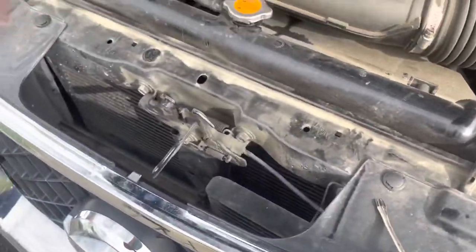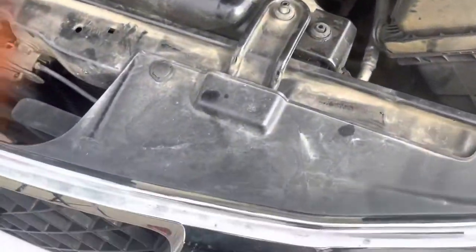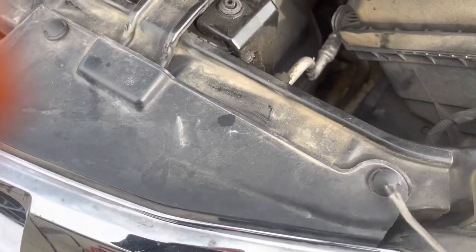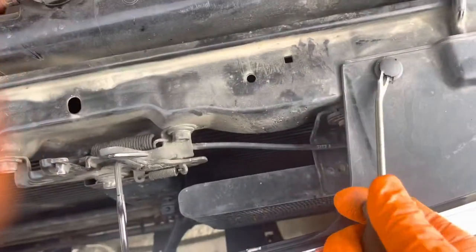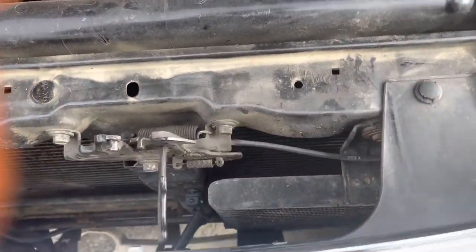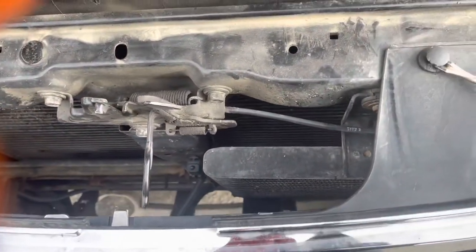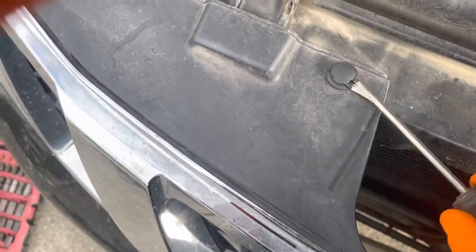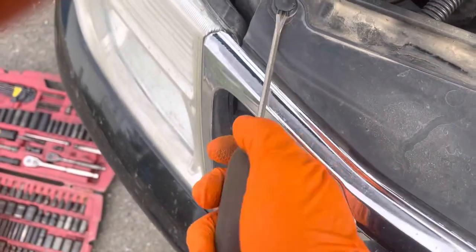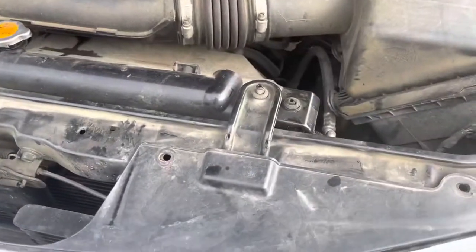We're going to pop these things out - with my luck I'll probably break them because that's how I roll. Underneath the oil leak - found it! This job that we're doing right here is actually going to fix it. It's a trans line that goes into the trans cooler; it's dripping a little bit on the fitting on the radiator. Never happens to me that you get two fixes for the price of one. As predicted, we broke one of these, so have some extras.